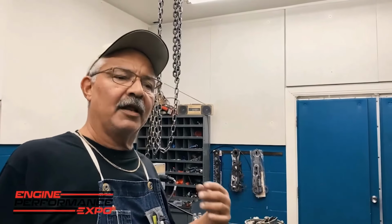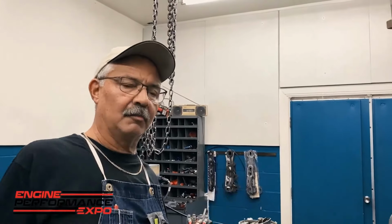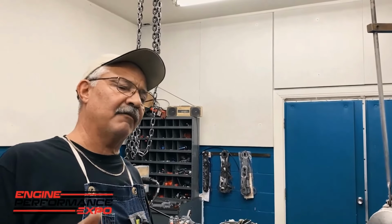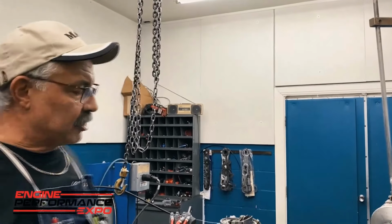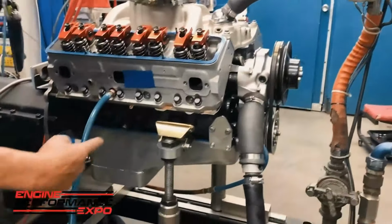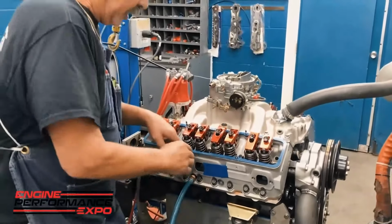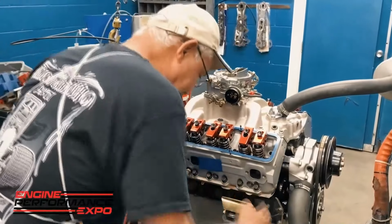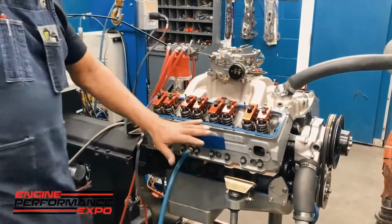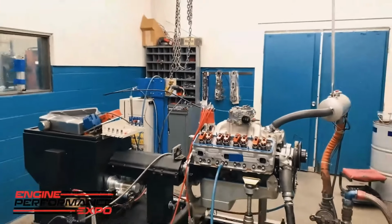The gasket works so well that that's not as big of a problem as it used to be. And again, on our Chevrolet sprint car motors, and I say that because now we're building Fords also, the Chevrolets don't have as big a problem as they used to, because instead of putting water in the front of the motor, like a normal Chevrolet is, we're putting water directly underneath, pointing at those 2 exhaust valves, and we're cooling that part of the motor first. We're letting the water spread out into the cylinder head, go back down into the block, and then we're taking it out of the block instead of putting it in the block right there. So that was the answer to Lake's reason as to why we actually use the tape on the exhaust ports.